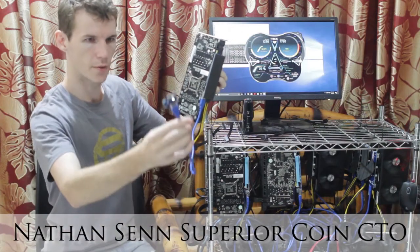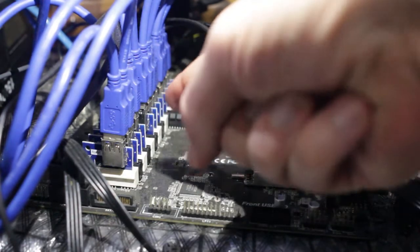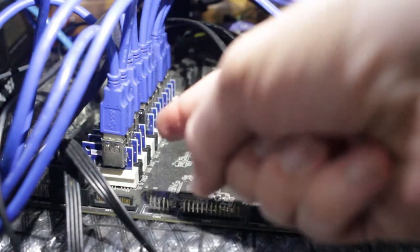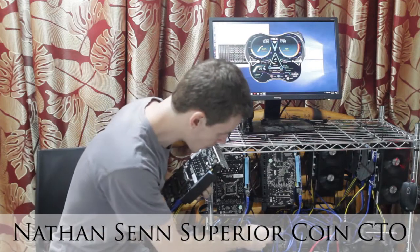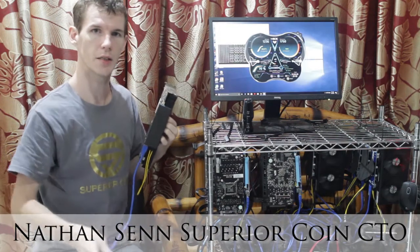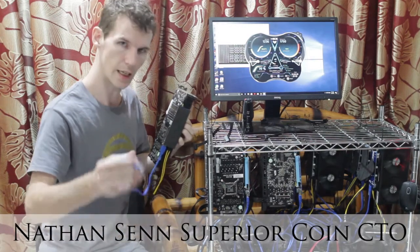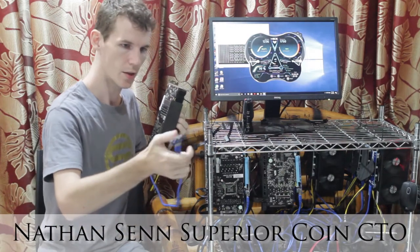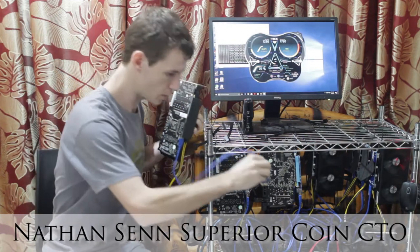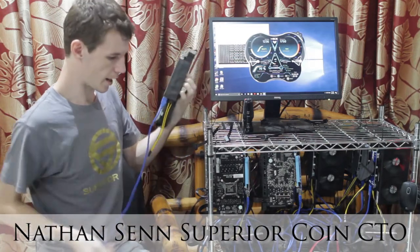And then you have here, this is the other cord. This actually plugs directly into your motherboard. So you can see down here, there's slots available. These are called PCI slots, and you want to make sure on all the slots that you plug them in exactly the same. There's one slot that's a lot larger, and on some boards there's up to 3 different slots that are larger. You want to make sure that you plug the actual riser, the PCI riser, into the correct position on that. And once you do that, you would then connect this part to your power supply.